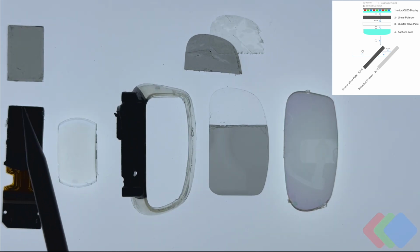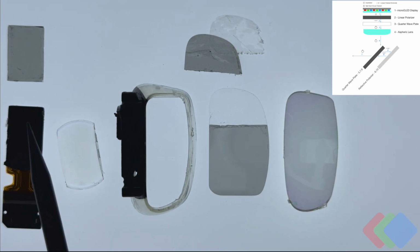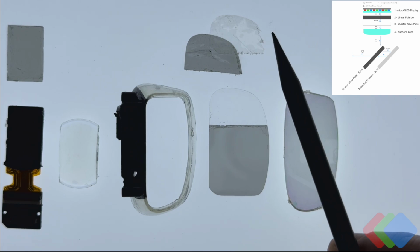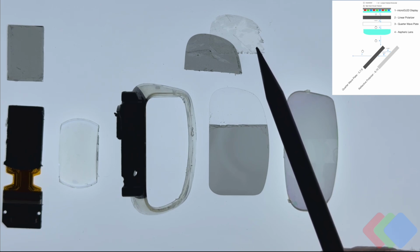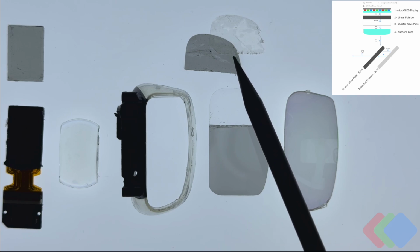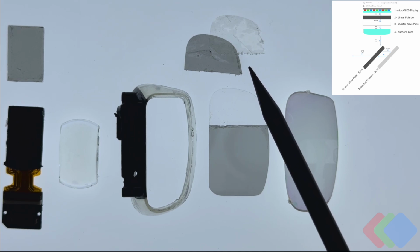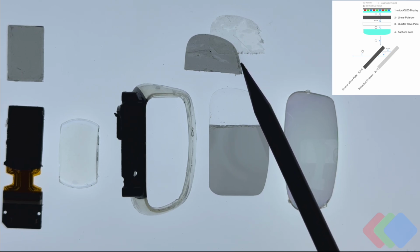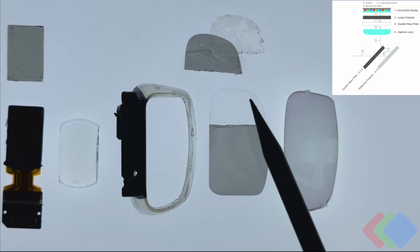So remember, we started off with circularly polarized light from the display that has had its circular polarizer laminated to it. We now enter and magnify the image and go to this first surface where we take that circular polarization and turn it back into a linear polarization state once we pass through the quarter wave plate. As we pass through the quarter wave plate and linearize our light again, we can reflect off of what's known as a reflective polarizer. Typical polarizers are absorptive. They will generally absorb light that is of the wrong polarization state and transmit light of the correct polarization state. But for a reflective polarizer, instead of absorbing light of incorrect polarization state, it will fully reflect it. And that's key to allowing us to do what we are doing here and folding the image in our birdbath